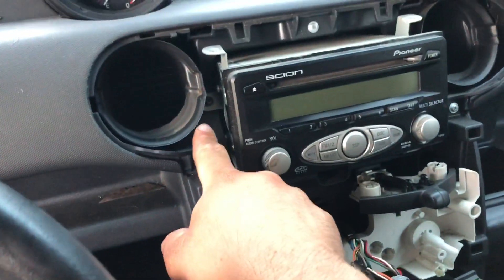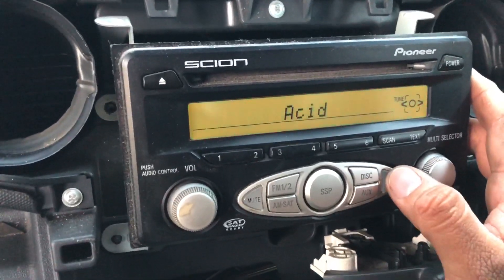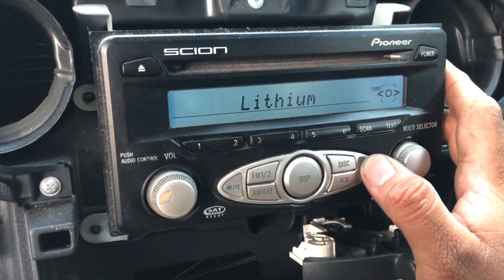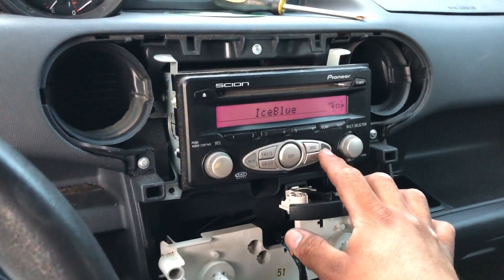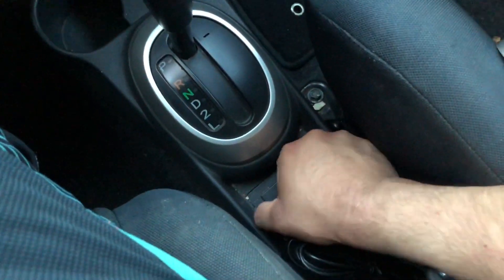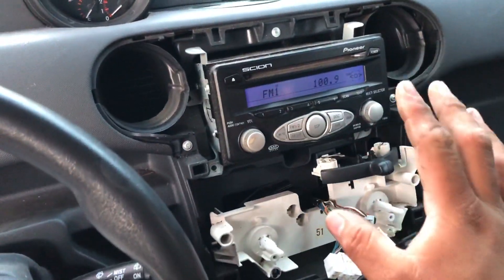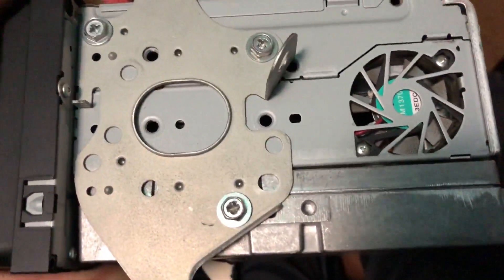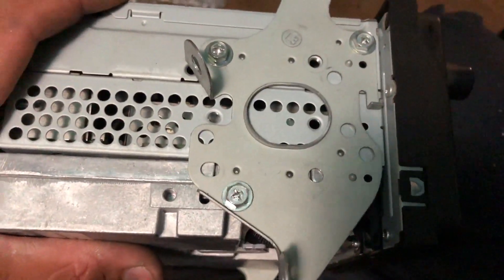It's really simple — we have four Phillips head screws and we're going to swap over the bracket. I didn't even realize this: the stock radio can actually change its display color. If I had this back in the day that would have been amazing. You can see how retro this car is — it has an iPod connector and just an aux input. But with this we're going to give it a new lease on life. When transferring the Scion xB bracket to the tC radio, I had to drill out this hole on both sides so the GPS unit came through onto the bracket. Now it's sturdy and secure.